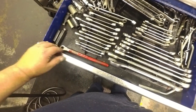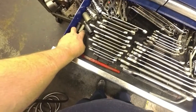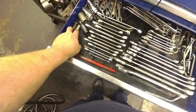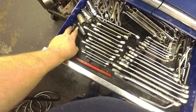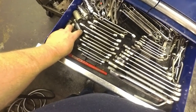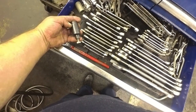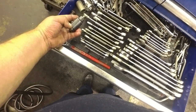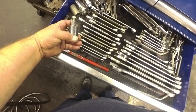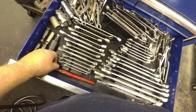This is a Blue Point so it's Snap-on — it came off the Snap-on truck. That's for doing the lever seals on the later model 4L60s. This either came from A-Tech or Snap-on — it's just the tool for doing the earlier model 350s, 400s, and 700s lever seals. This would do most all your early GMs. This here's for doing the torque flight lever seals in the vehicle — this is the installer for it, this is the remover. It's got KD 2392 — I think I got that off the Snap-on truck back in the day.